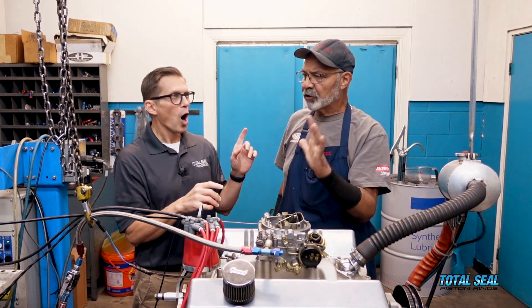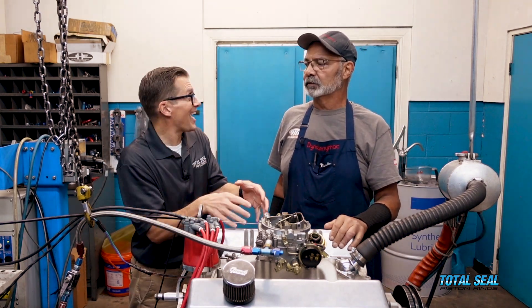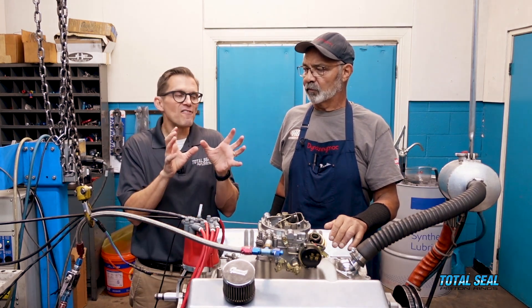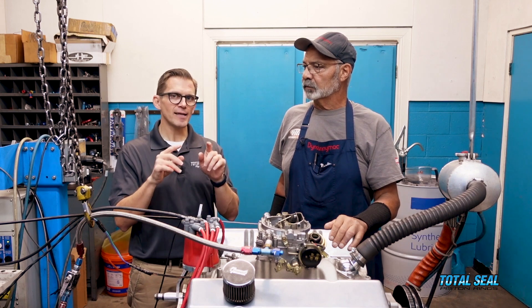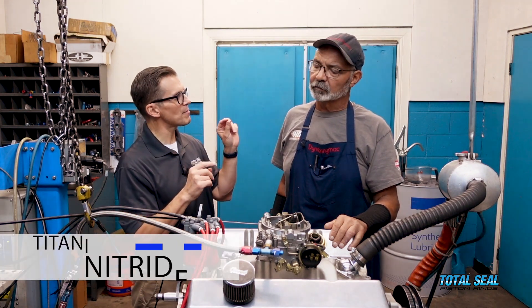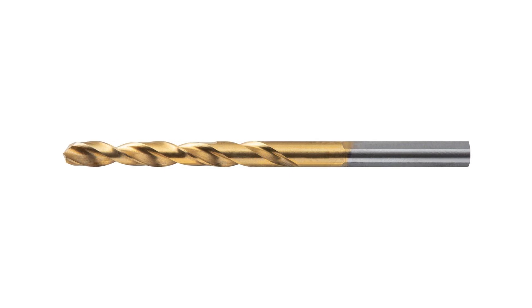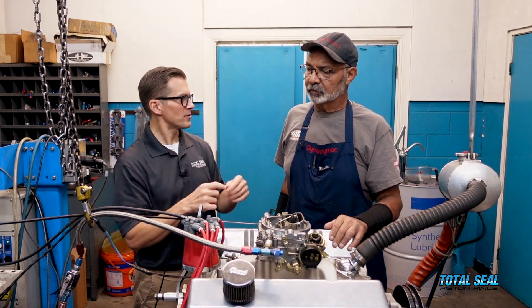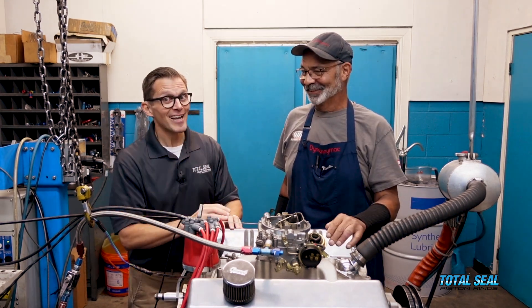It's still very, very hard — actually harder than chrome. It's important to do the test to see will this thing break in and how functional can it be. And the other thing about this is that titanium nitride is the same gold coating that's on drill bits and machine tools. So if you've got a drill bit at home that's gold coated, that's your favorite drill bit because the thing never wears out. There's a reason for it — because it's titanium nitride.